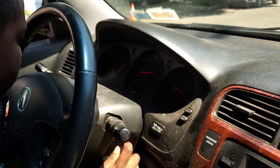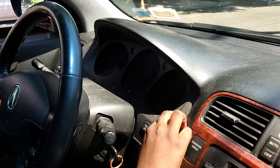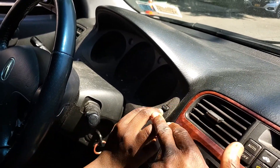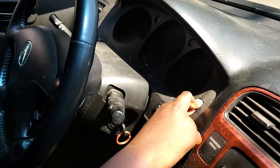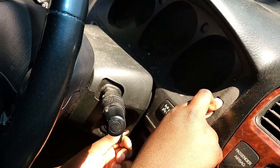So what are you going to do? Turn the key off. Okay, you turn the key off. Now with your one hand, push these two buttons together — both of them. You push, you hold, and then hold into it. Don't release it. Now you're going to turn the ignition on with the other hand. While you're pushing that one, turn the key on.